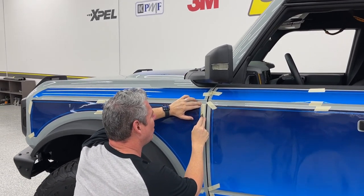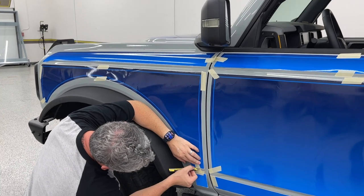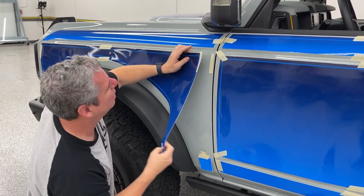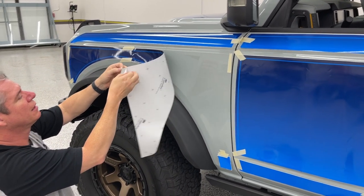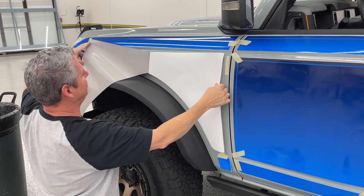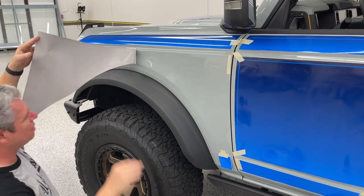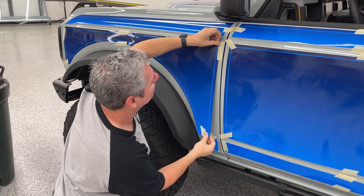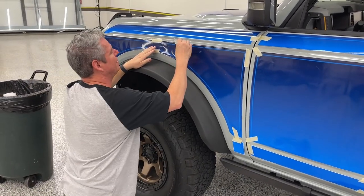And I've got just enough of that white border showing. Again, you can cut on that without cutting your paint. I'm going to mark there. You just want to drag that, barely score that. And then make sure these are still attached. And we're going to do that hinge again. Again, I cannot say enough that this would be a lot easier if it was masked. I really just want this to be your demo. Little quick tutorial. Same method, just tack and tack.